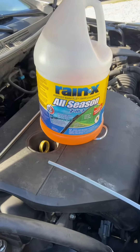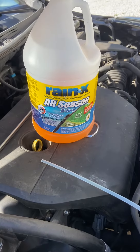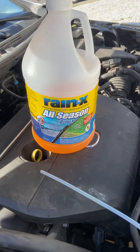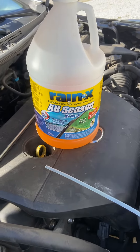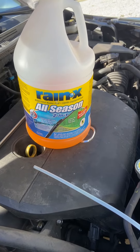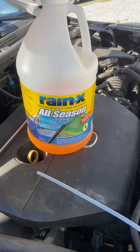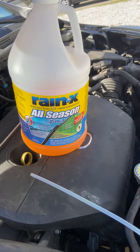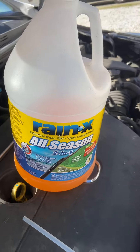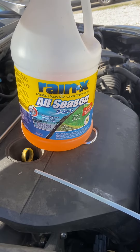Here's a quick video — this is a 2015 Mazda 5, but this really applies to all vehicles. When you go into most quick lube places, they're going to go ahead and top off your windshield wiper fluid for you, and they almost always use regular fluid, sometimes just straight hose water, which is terrible. It'll clog up your sprayers. Here in Northern California we get down to freezing a good bit in the wintertime, so the stuff they put in there will freeze to your window.